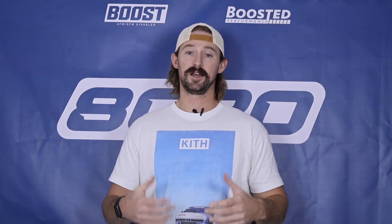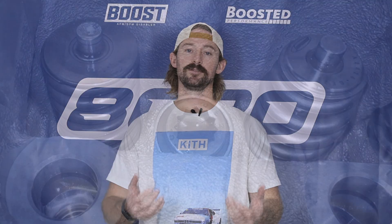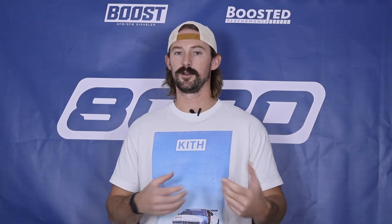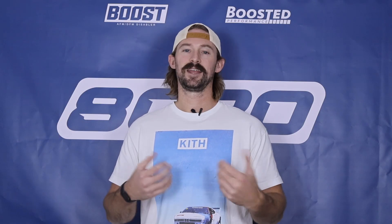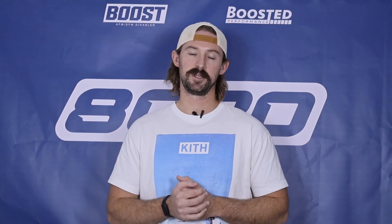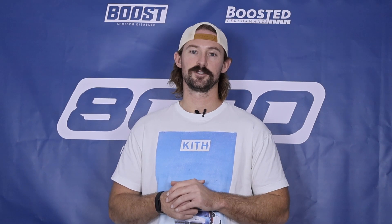Fifth on our list, also caused by the hot V design, is excessive valve stem seal wear. The valve stem seals are sitting on the top side of the engine where the turbochargers are, so they wear down more over time. This leads to excessive oil consumption and can cause blue smoke on startup as well. This is one of the more challenging problems to fix because it requires digging into the inside of the motor to replace and fix the issue.